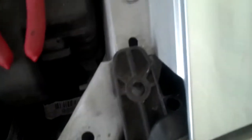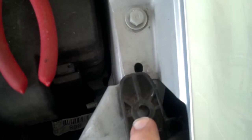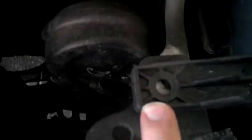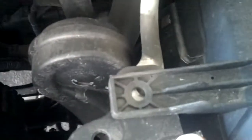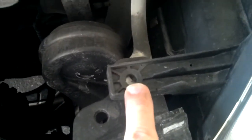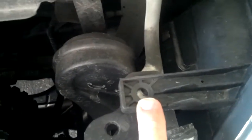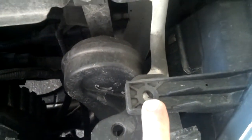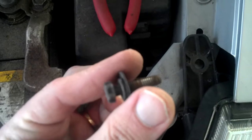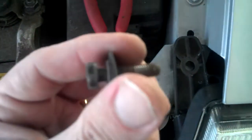The next step is to come over to the headlight assembly. There's a hole right here at the top of the assembly that has a bolt in it, and another one down at the bottom. I've already taken them out so they're not lined up at the moment, but just to give you the idea of where they're located. I used a 10mm socket to get those loosened up — and they're about this long, as you can see from this one here.